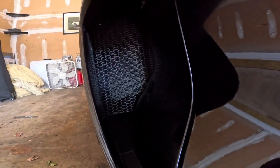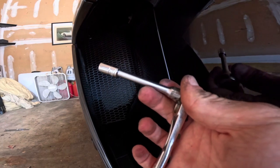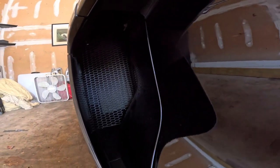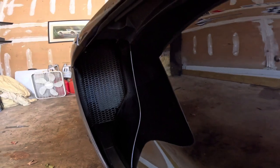Pro tip: when reinstalling, you can either use an 8mm box wrench, or you can push it out of the way and get in there with an extension to get that 8mm tightened right up. And there's the finished product on the passenger side. You can get these and more at RadiatorGrillStore.com.